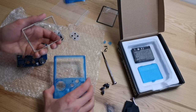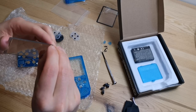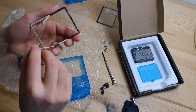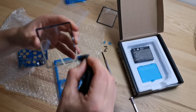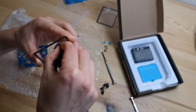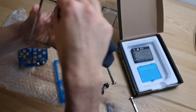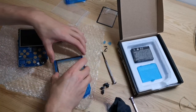Now we're going to stick it back to the front case. We need to remove the second protective layer from the double-sided tape. With your nail, just pull it off. If you put a finger on the corner, wipe it again, being careful since the protective layer is now removed. Make sure it's clean. Then remove it all the way and apply it directly on the cavity.